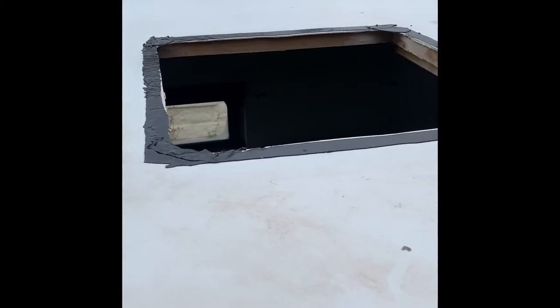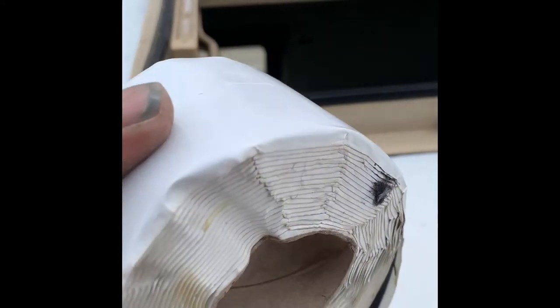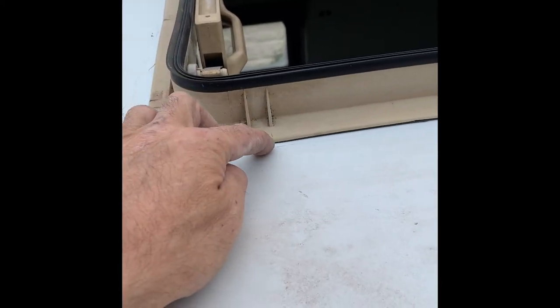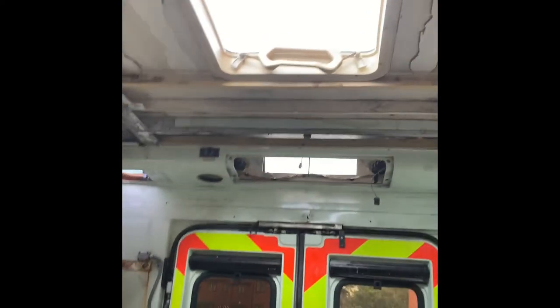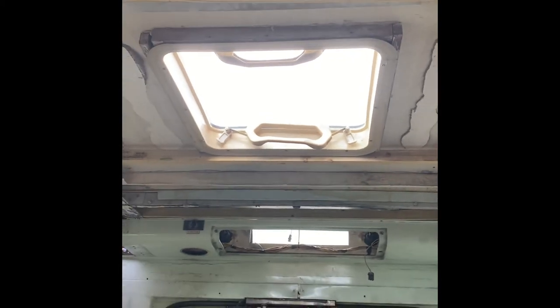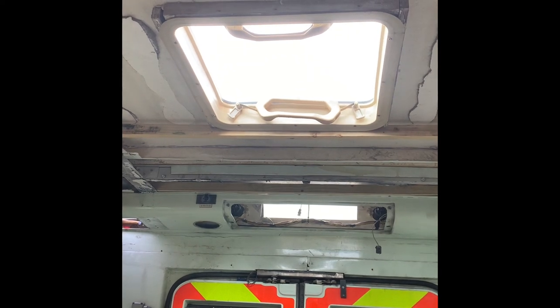There we go — I've stuck the tape all the way around as you can see. Now I'll place the roof back on top, screw it down, and that should seal it. I've put the roof back on now and trimmed around the edges to remove the excess bitumen tape — it went on a lot thicker than needed. Inside the van I've put the bottom clamp ring on which pulls the top down and sandwiches it together. That's how I've resealed my sunroof. Now I need to put the top cover back on, wait for it to rain, and see if it leaks.